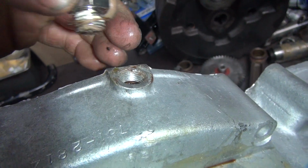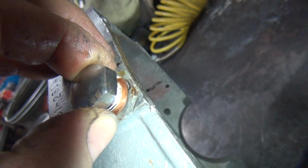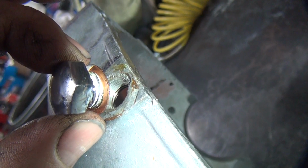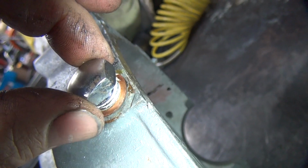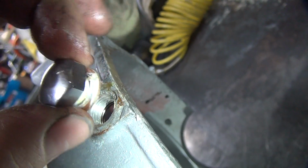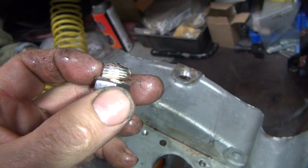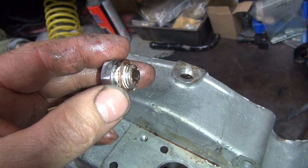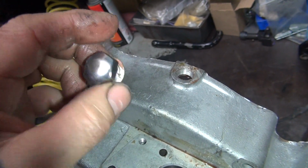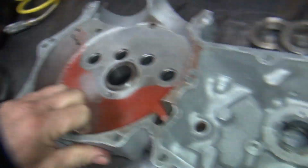And the sealing washer has the same problem. It's right on the edge of the thread. I mean the crack. See right there, you can even see the breakaway spot. What the hell is that going to do for you? It's the same deal. It's right on the edge of that break. It's going to leak. So who knows what that's going to do. So this is not the correct part. It's got damage. More issues.